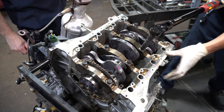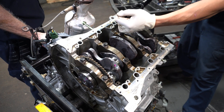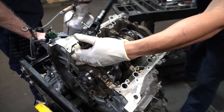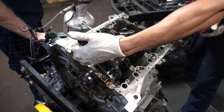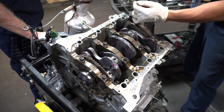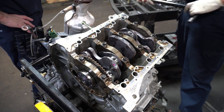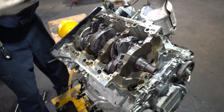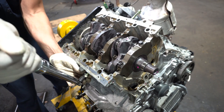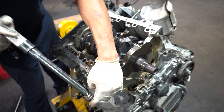That's my coworker Mark — just coming over to see what I'm doing. Just moving down the line, easy peasy. If you feel any resistance when you're turning the wrench while degreeing, stop, back it out, clean it up, and do it again. The side bolts get torqued — they do not get degreed — but they also have a sequence, so you have to go in sequence.